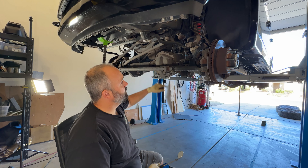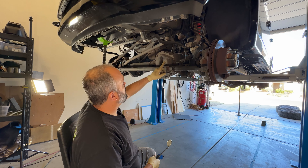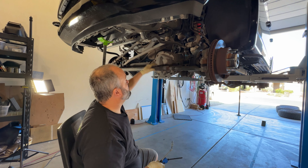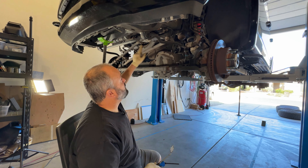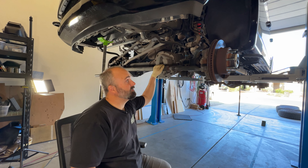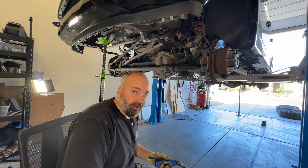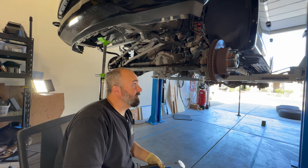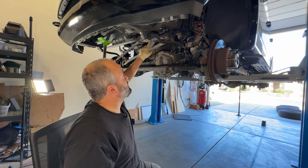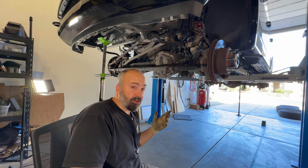While I'm in there — famous words — I am going to lube all of the adjustment points. There are three of them here: your steering center and then your tie rod. When you adjust the tie rod, you're adjusting the toe in and out on your wheels. When you adjust the arm up top, you're adjusting the centerline of your steering wheel. So you really can do an alignment on these at home, as long as you're not trying to measure caster or camber — it's basically a string alignment, fairly simple. I'm a firm believer in long-term maintenance, so I'm going to wind up lubing a whole bunch of the bolts on this front end, at least just the threads, to provide a little bit of anti-rust protection for later.